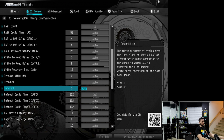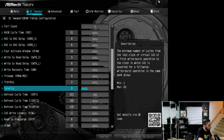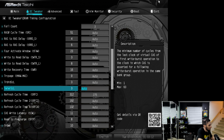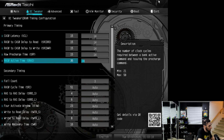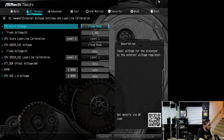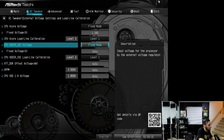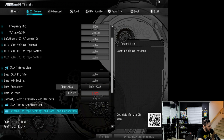This is already proving to be such a long-ass video. So, I know this one's already 275, which was my magical number for these sticks. 275, CL 14, 14, 14, 34, 1.5 volts, 37, 33, 4.4 gigahertz, and voltage of 1.38, level 1. Oh wait, I want this to be auto, not fixed. Yeah. And that's it. That is the best settings. Best, I should say, dailyable settings.